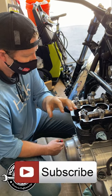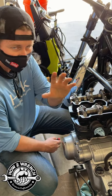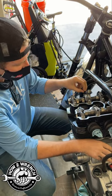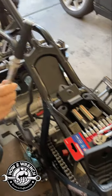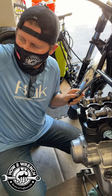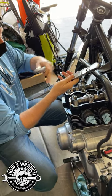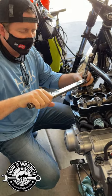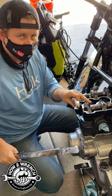It felt good on the rest of them — we found one bad one, we're gonna talk about that and it's gonna blow your mind. But we really want to make sure that we're using on these small fasteners — on six-millimeter or quarter-inch fasteners — a quarter-inch drive torque wrench. If you go to a three-eighths, even though the torque wrench might be within range, you have so much leverage it's really easy to accidentally go past the click and damage the bolt.